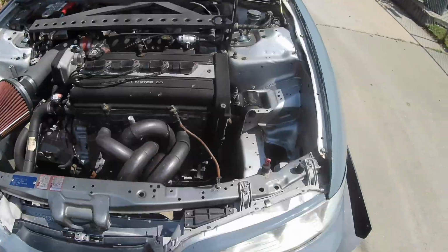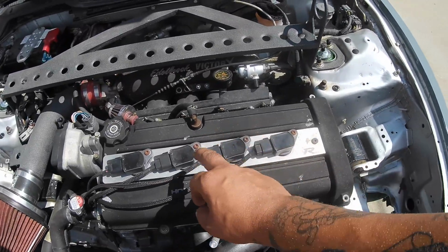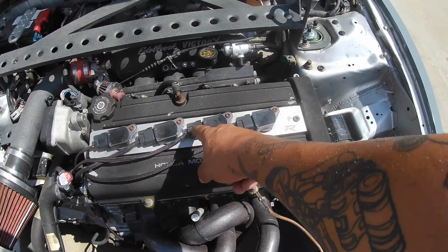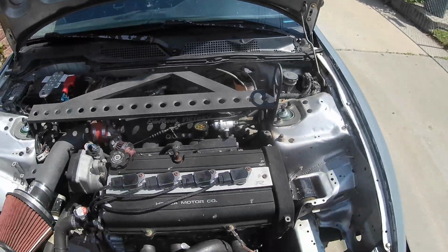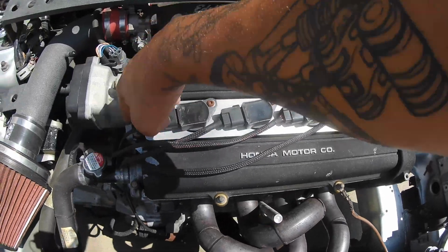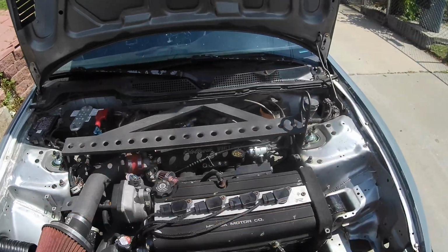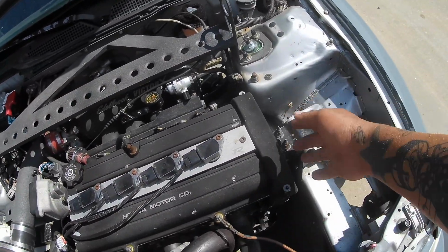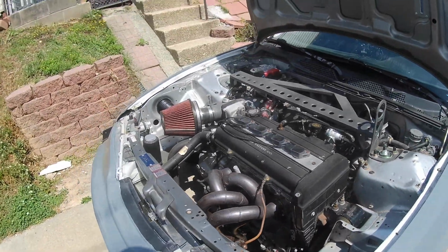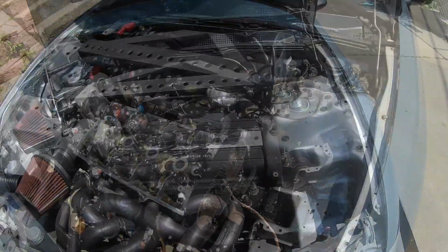So what I'm going to do is pull off the valve cover. For me, I have to remove this coil with this Allen key, because there's an Allen bolt underneath of this, and one here. Pull the plugs out, or the coils out. Take off the 1, 2, 3, 4, 5, 6, 7 valve cover bolts. Just flip that aside, and then maybe take off the timing cover on the side, which is 1, 2, 10 millimeters. So let me pull this off real quick, and then we'll inspect the area to see if it's wet.